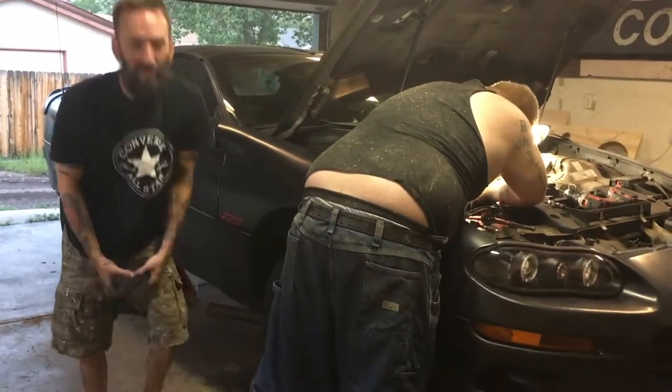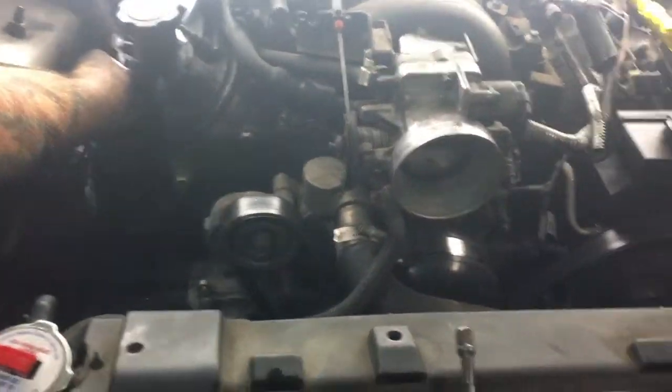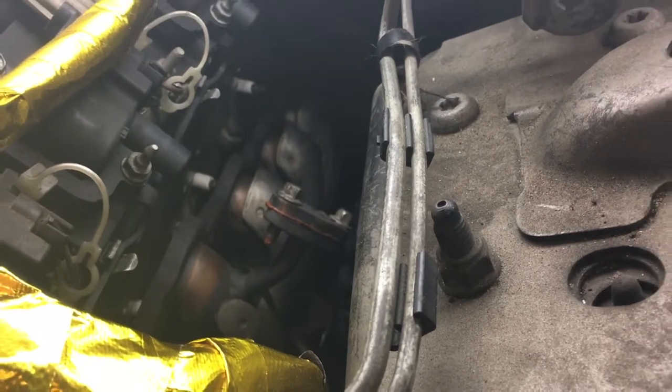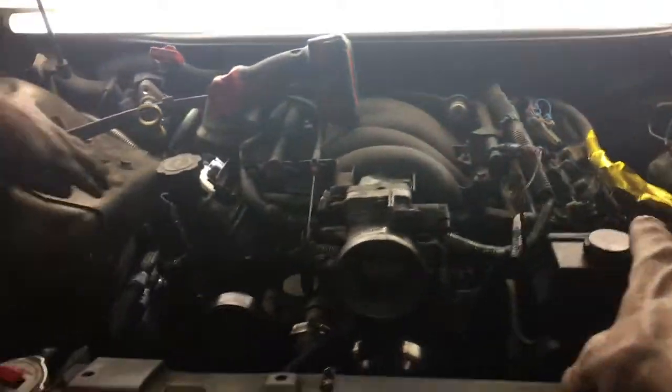Yes, they're great. So we've been successful in doing the complete air conditioning delete. He also got the header disconnected. The coil wires are out of the way. Now we just gotta finagle it out the bottom. I think I can get it out like that. We may end up cutting the cap off to get it out. I think that's what I did on that.